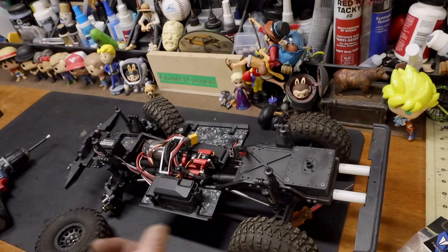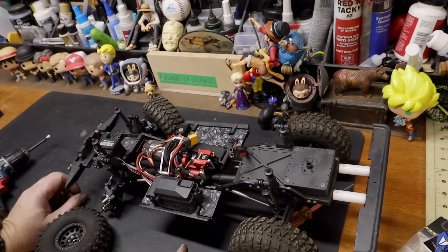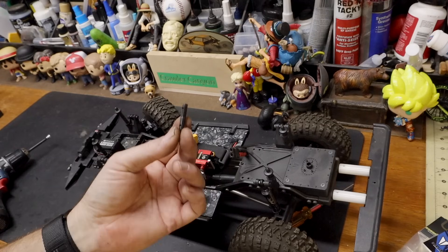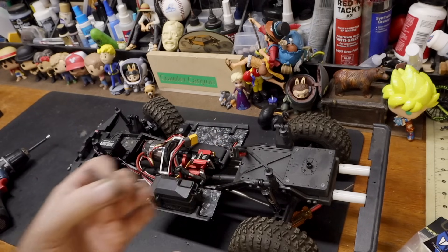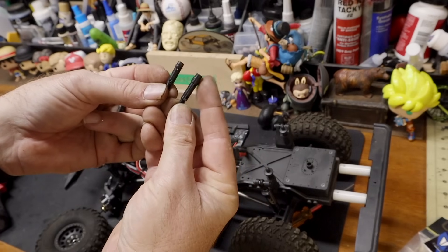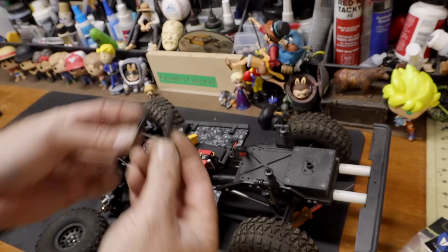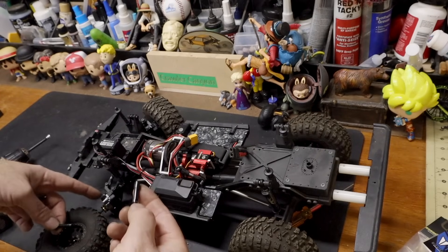What Triall has done is they've made a pretty pancaked portal cover — the hex sits down into it about four or five millimeters — which makes it so you cannot use the Vanquish hex. The Vanquish hex sits down inside that hole. On the Vanquish they get around this problem by making a huge recess where the whole SLW hub is basically down inside, so you have no fitment issues. The Vanquish stub was way too short — no hex I put on it would allow me to mount the wheel.